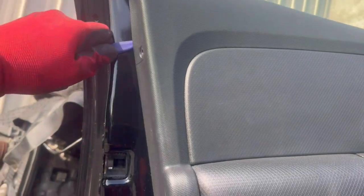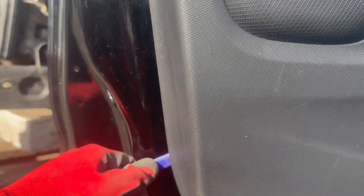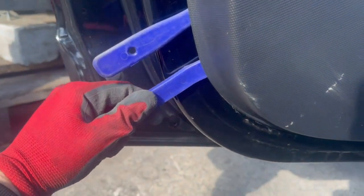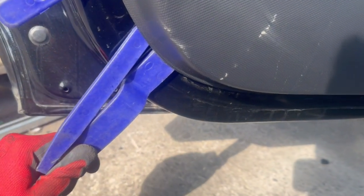For this part, there are clips on the inside of the door panel. You'll need to get in between the door panel and door itself with a plastic tool, pull the bottom out first, and then slide it upwards. Keep in mind these clips can break — I will show you when I take the door panel off.